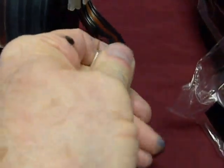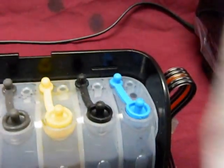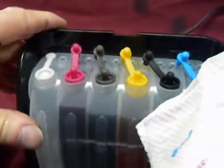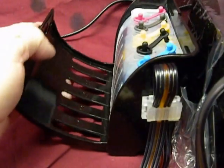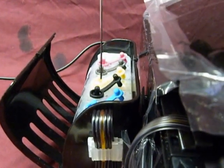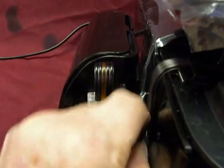Remember, we rocked the ink bottles. I'm going to open up the clamp — it's very important. If I had forgotten that, I wouldn't have got any copies or would have starved the printhead. Now the next step is to open up the little vent plugs in the back. Sometimes if you have a paper towel, you won't get any ink on your fingers. It has to be open, because air has to go into the isobaric chamber for the ink to flow to the printhead. By having the long injectors, you'll be able to go right into that large opening — plug off the small one, open up the big one, and you'll be able to go right in and fill the ink tank back up.